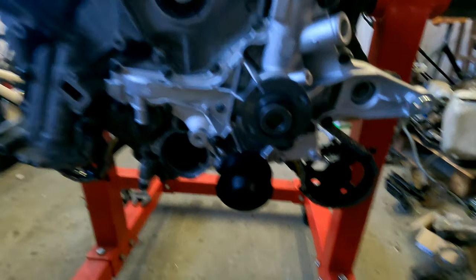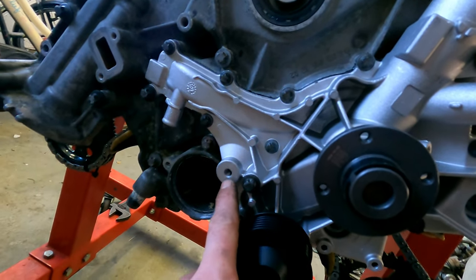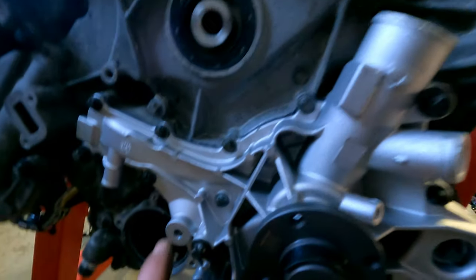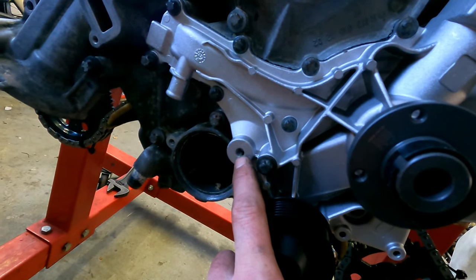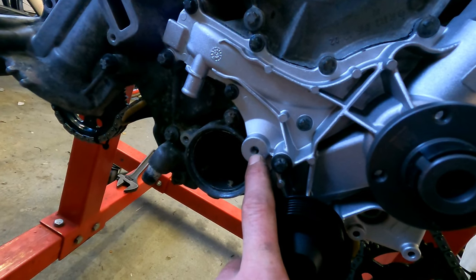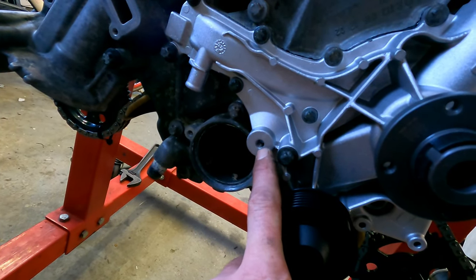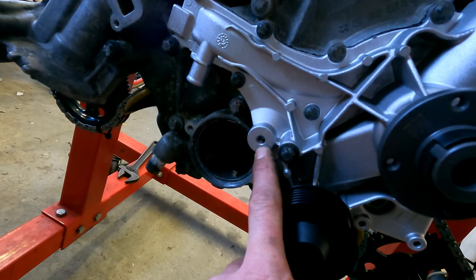A few things that I want to mention, for example, on the water pump. If you get this water pump new, this M8 thread is not in there. So the manual states that if it's not a tapped thread, it needs to be tapped in there. You can do it with a bolt. I think that's strange, but then you have to put this to 35 newton meters and otherwise 25.